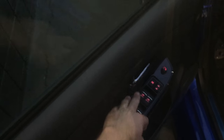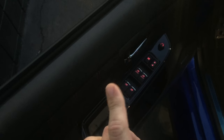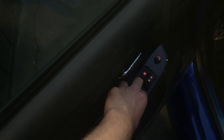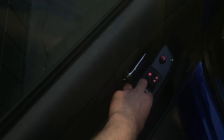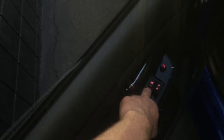So with the driver door open, I'm gonna unroll the window all the way — but I only pushed it to the first switch position, I didn't push it all the way down. And I'm gonna do the same thing rolling it back up, and I'm gonna hold this switch for about three seconds. And now if I've done that properly — automatic window works.